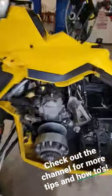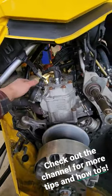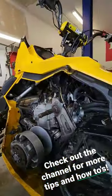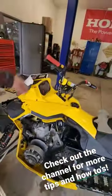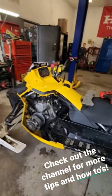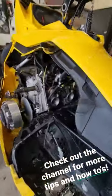Going over a few things — first thing I did was pop the power valves off and made sure nothing was stuck and jammed up. But then I said, let me go look at the carbs, so I ripped off the secondary and took off the air box. I think this is a 2012, actually — this is a RS 600.